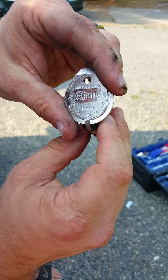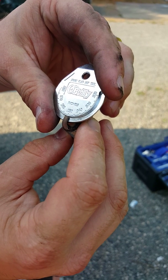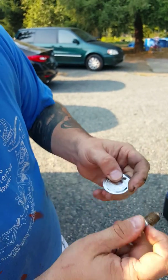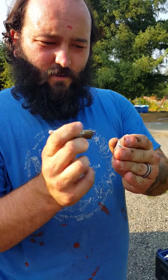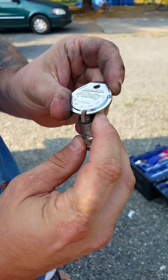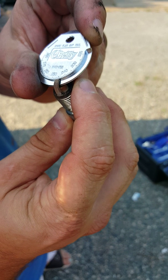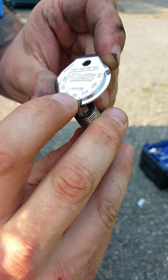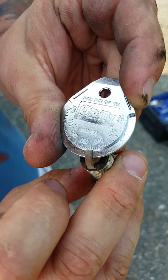You'll run it gently around the side until you meet resistance. I've met resistance right at point zero five two, so we have to close the gap up on the spark plug. I'll take the spark plug gapping tool and give it a quick little tap like that, and it'll close it up. Now we're a little bit shy — we're at point zero four seven. You always want to read the spark plug gapping tool on the far side because that's the thickest edge and that's where you'll get your proper reading.